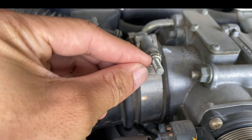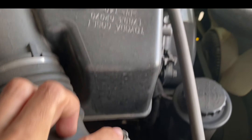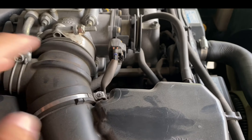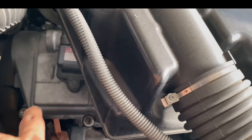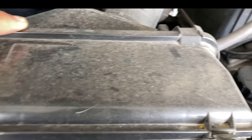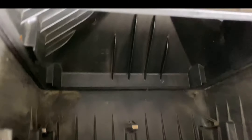We need a 10 mil for this, this, and this. Pull this off so I can get to the plugs under here. And here's the air filter — pull these down, lift this up, pull these tabs. Boom, got access. Pull it out — it's dirty. Been a while since I changed this. Make sure there's nothing in here, like leaves.